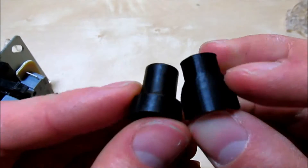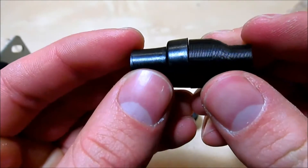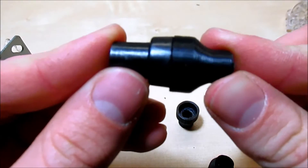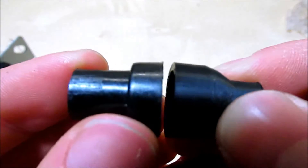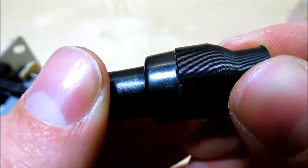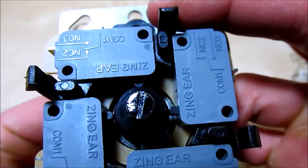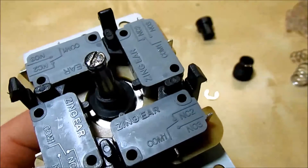Here's a comparison. What I did is make the outer bottom cylinder a little bit larger in diameter. Here are a few variants — this one has a significant diameter increase. This one is a little harder to see with the plastic, but instead of the tapered edge on the original component, it has a more symmetrical straight 90-degree edge. With this replacement action plunger, there's very little dead zone left before the micro switch is triggered.